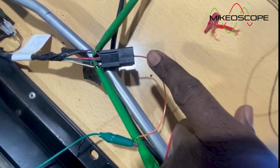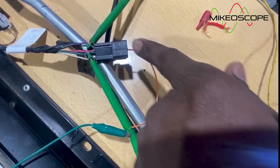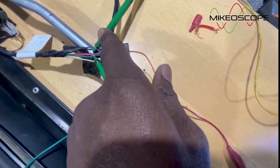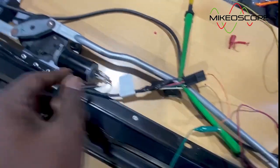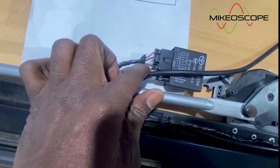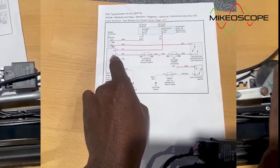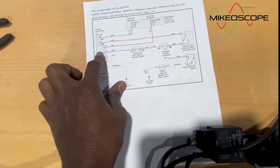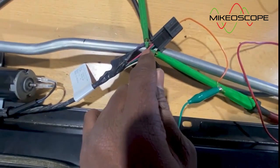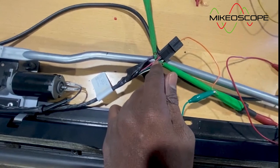And what I have set up now is that I'm back probing this wire, which would have interfaced with that connector. So that connector has a 12 volt voltage that's coming into it. And that should come into this purple wire here, okay? That's this one. That's a necessary condition for this motor to be controlled. The reverse circuit needs to be in the open position for this to operate. So what that means is that over here on this red wire, we don't need to do anything because it's already open. It's an open circuit mode, okay? We don't need to do anything with that.